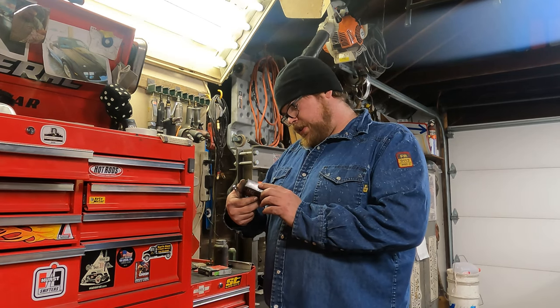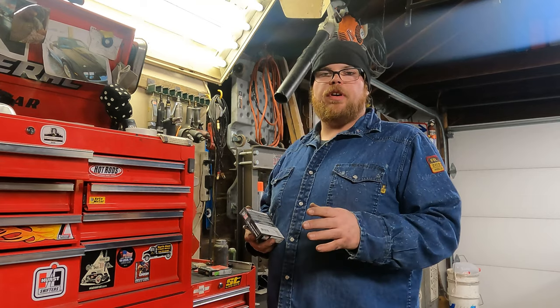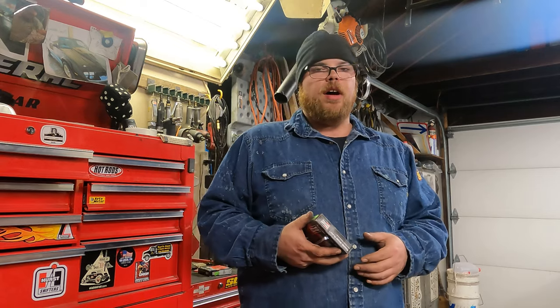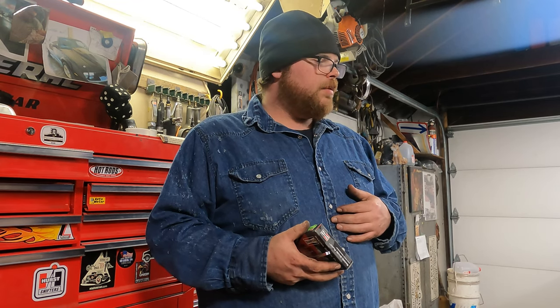I don't really know a good... You know, each application is going to be different. Whether you run a nitrous, whether you're running a turbo, if you're naturally aspirated. I just recently switched the car to E85, so I don't know a lot about it. And I'm not 100% sure what heat range to run. So we're just taking a ballpark guess to get us started for now, and we can always adjust as time goes on once we learn more, figure out a little bit more.